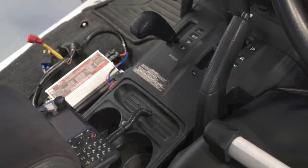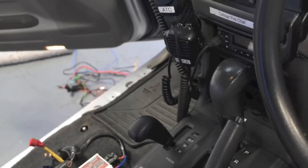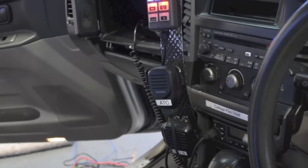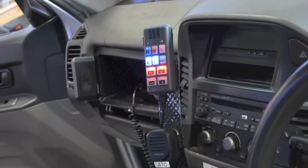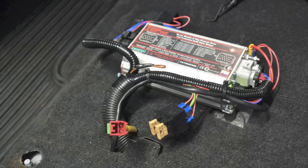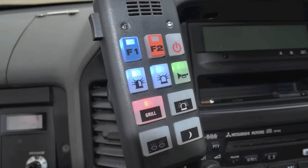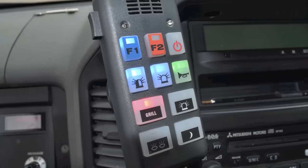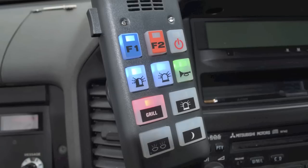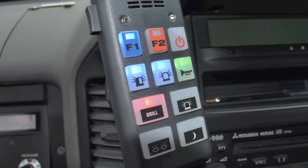Here's the inside of the vehicle. You can see the Tetra radio head at the bottom — that's for West Yorkshire Fire and Rescue's radio. There's the power module for the Top 112, two radio handsets, the analogue radio for the air traffic control and the airport fire service's internal radio, the message board controller, and the new addition which is the Top 112 handset. Here's a look at the power module — it's not very big at all. It's got the integrated siren amp, all the power outputs, and CAN connectivity. It's quite a small unit that fits under the seat. You can also see a close-up of the control head and all the buttons. The moon button, which we didn't explain before, is the one controlling the dim mode on the light bar and the grill lights.